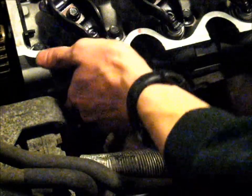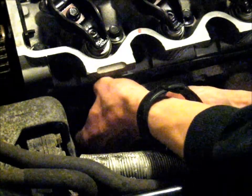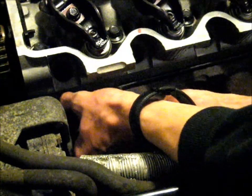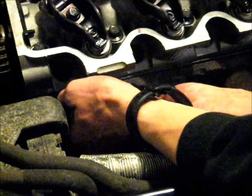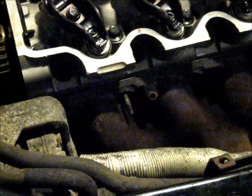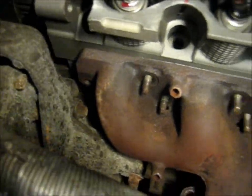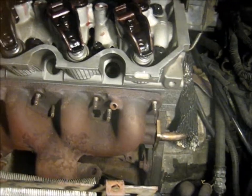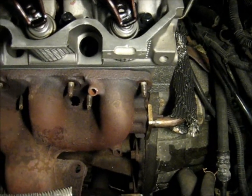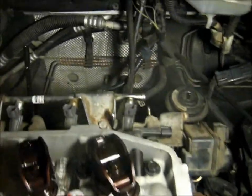You guys can see that good. Now I'm going to install this stud through the gasket there and into the head. Sweet, so that's working good now. I've got all the studs installed except for that last one, but it really doesn't look like it'll be too bad. So the trick here is: install the rightmost stud, install the gasket, install the exhaust manifold after the intake runner.